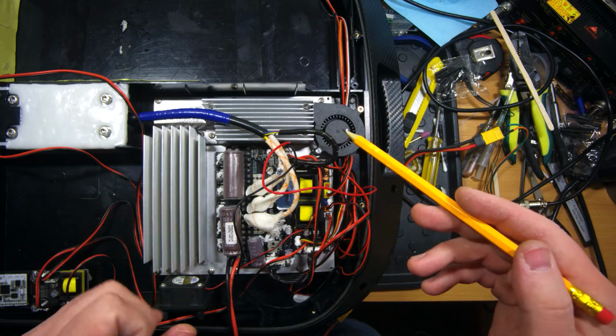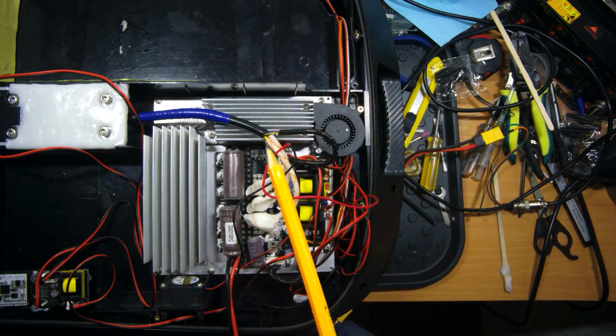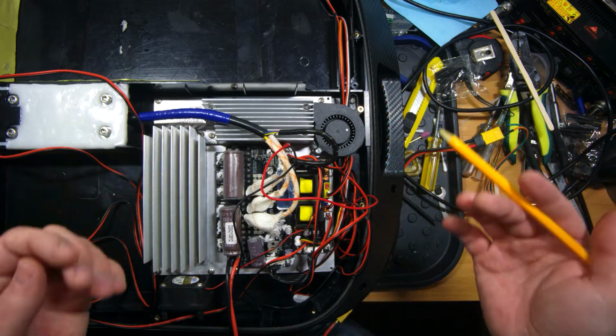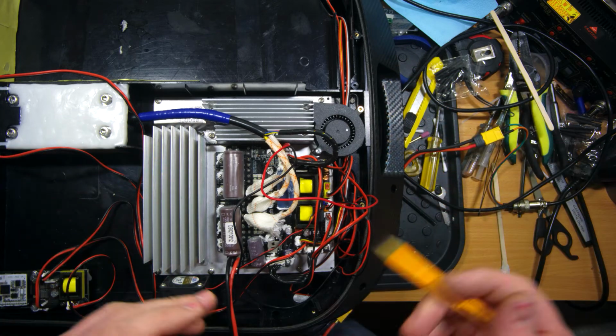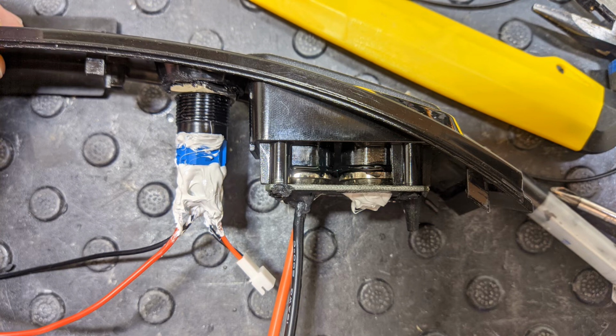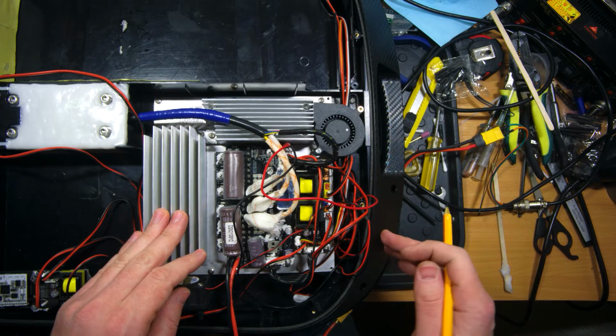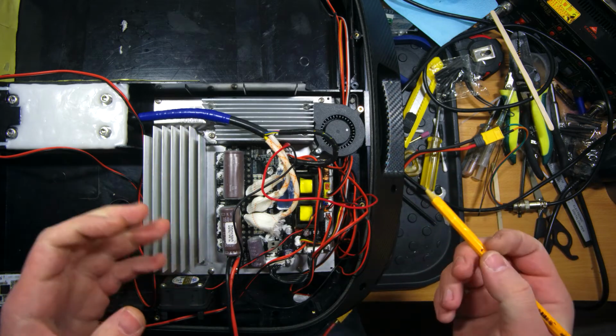Of course, it is necessary to pay attention also to the backlight, for the voltmeter. Also, I've covered all the adjacent areas of two parts of the inner shell with the sealant. I've put all charging ports and the buttons on the sealant as well to make sure that no water will get through them inside the wheel where the electronics of the EUC is located.